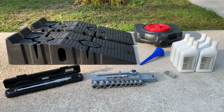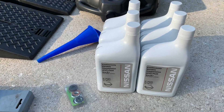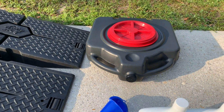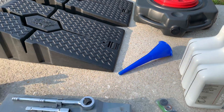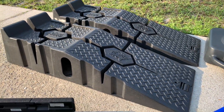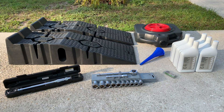Now let's go over all of the tools and parts required for the CVT fluid change. You will need proper CVT fluid for your car, a brand new drain plug gasket, a small funnel that can fit into the fill pipe of your transmission, a drain pan, wrench and sockets set, car ramps, and a torque wrench. If you need help finding any of those parts or tools, feel free to check out the links in the description area below this video.